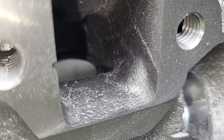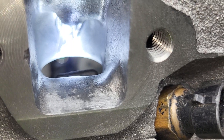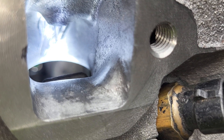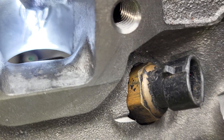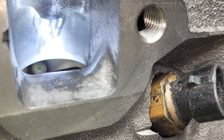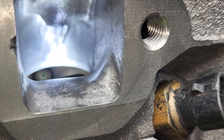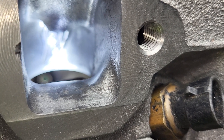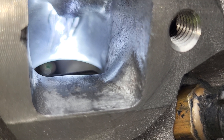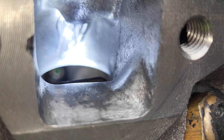You're going to see that bulge on the bottom right of that exhaust port. How come you're not knocking that right out? Well, think about where it is, what purpose it probably serves, and how thick the iron is. Very good chance they were having problems with plugs over-temping and causing detonation. So they added that little lump and put a little more water jacket there to get that plug a little cooler. I would not take a ton of that bump off. It's a very tight radius, tough to get the sonic in there, and it's a low-flow area to begin with — so you're not going to gain any power by taking it out.